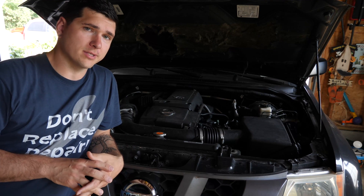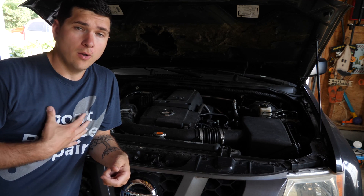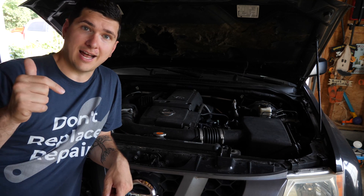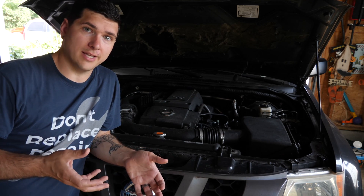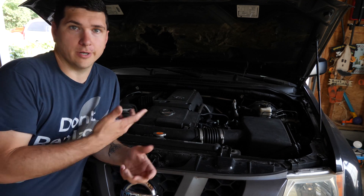There are two ways you can take the oil sample. You can take it during an oil change, which is how I'm going to be doing it, or you can use a pump that you put right down your oil filler neck and collect it from there. I would just wait until you're going to do an oil change — that way you can get the sample while you're doing the oil change. It's quicker, easier, and you're getting your oil change done.